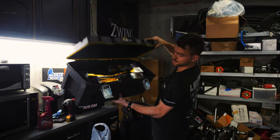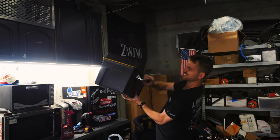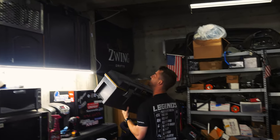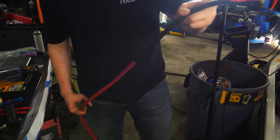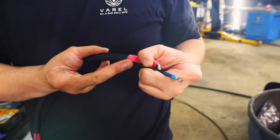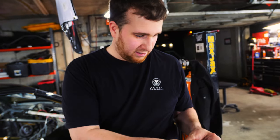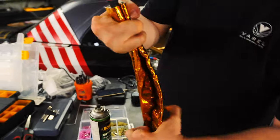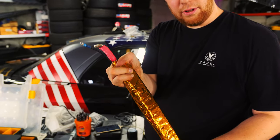We're done with our Design Engineering treasure chest — typical fashion, you seal her up and throw her back. We've got our starter cable done. We have this woven nylon glass fiber sleeving rated for a thousand degrees Fahrenheit, which we want because it's right by the headers on an LS engine. We put the trigger wire for the starter solenoid in line with it too, so it's one whole assembly. And then for added protection, we're going to put on this wonderful gold sleeve from DEI — Design Engineering. We're doubling it up, just like you would double down at a roulette table. Very similar fashion, plenty of heat protection — never have an issue with this cable again.